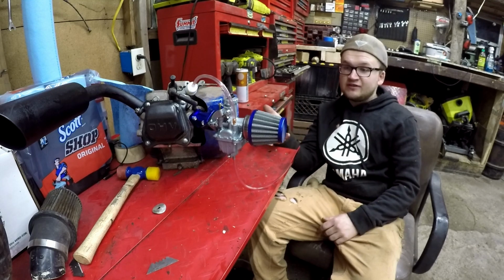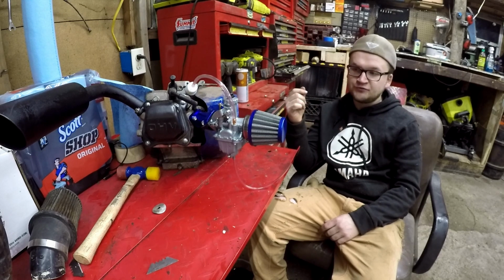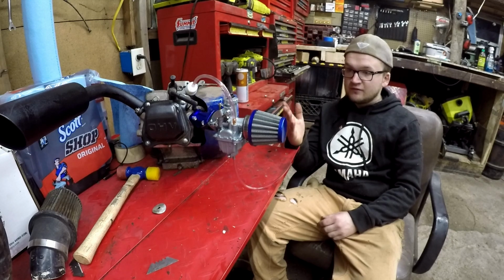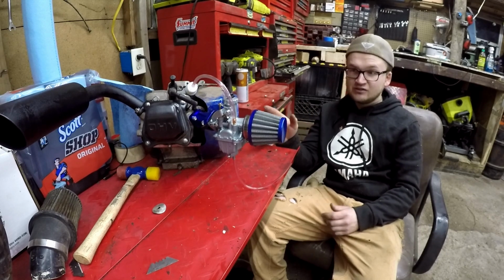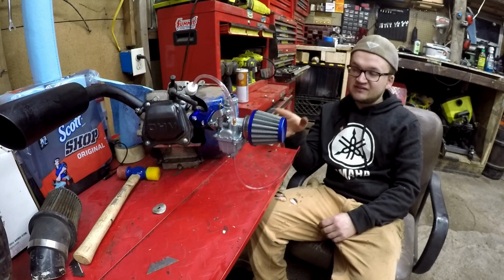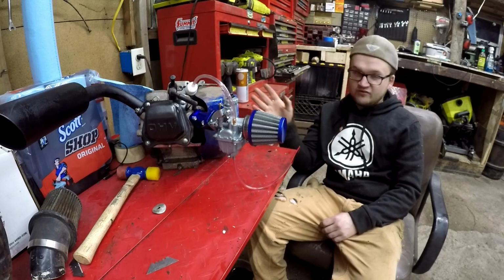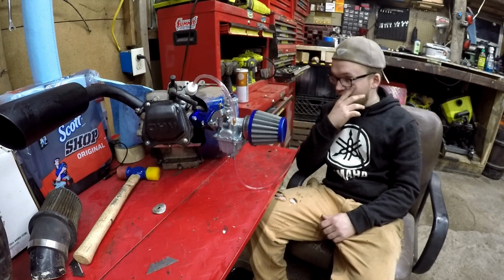But alright guys, I hope you enjoyed today's video. It was just a quick little tutorial on how to install one of these. I mean, there's probably a billion videos on YouTube, but I thought why not. I got the parts, I'm putting them on anyway. Now, I'm not totally sure what the jetting is going to be like for this. I know that these come lean when you buy these kits, but this is a 196, so it might actually be about perfect. I'm not totally sure yet. We're not going to be able to test it until I run it, but it's probably going to be a while before I run it, because I think I'm going to be doing a whole build series on this engine. We're going to do billet, flywheel, everything, all the works. Heavier valve springs, stainless valves, the flywheel, all sorts of stuff.